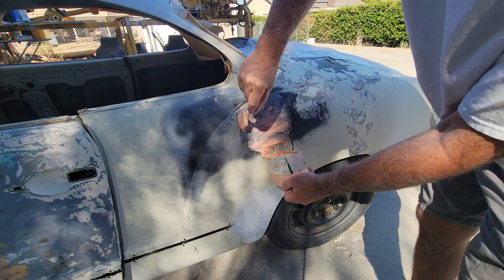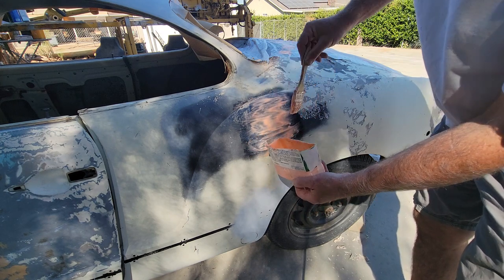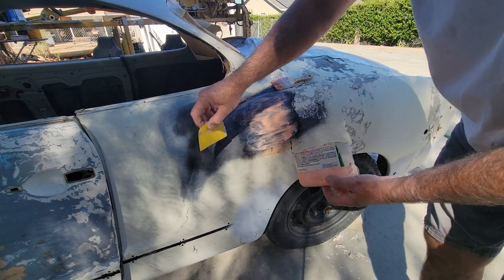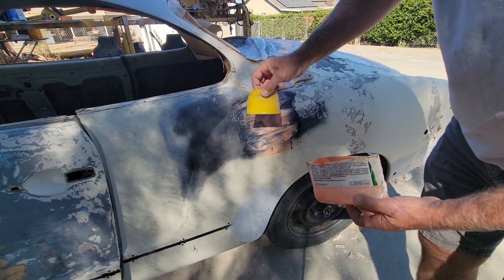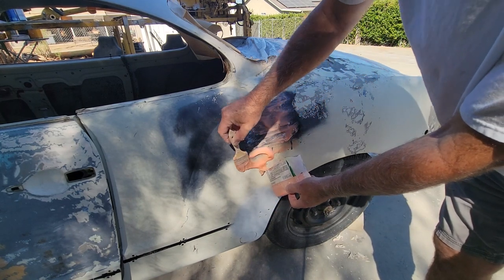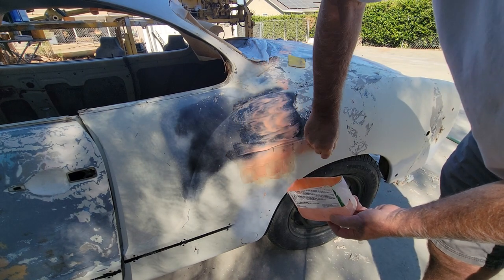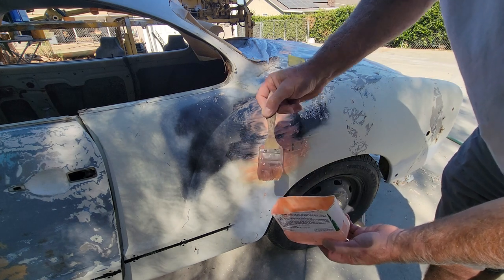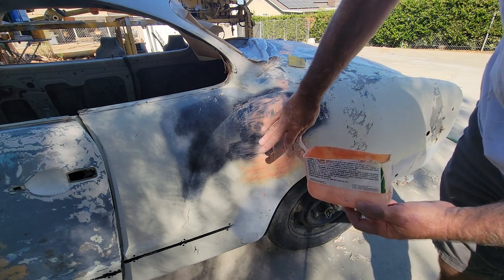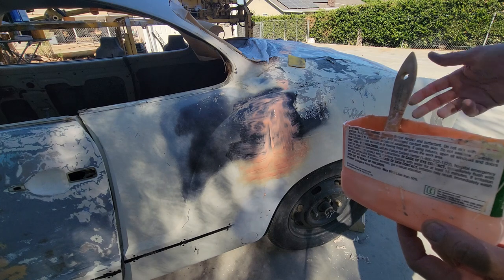Cross-brush it, put it on, cross-brush it a couple of times, and just lightly tip it with the brush. Another thing you can do with this product is use a bondo spreader. Generally when I pour it on the roof, I just take a bondo spreader and spread it out thin. On vertical surfaces, I scoop it out with the brush, let it kind of run down a little bit, then start cross-brushing in different directions to spread it evenly. This is just a chip brush. Then when I put my plastic on, I rub my hands over it to even it out. It works really well for old synthetic enamels and maybe old acrylic enamel.